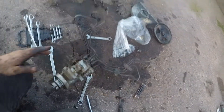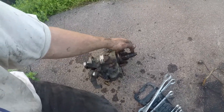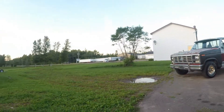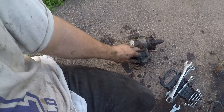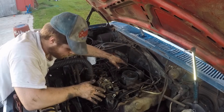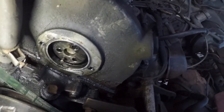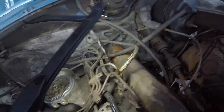All of the bracketry — the spider legs — are now attached to the new pump. There's the old pump for reference. There's a little tiny fitting at the back we need to steal off the old one and put on the new one. We also need to transfer our fast idle module. All we've done is line up the pins underneath and stab the injection pump right back into where it was sitting — nice and easy, no real problems. The pump is fully seated and all of our injection lines are where they need to be.